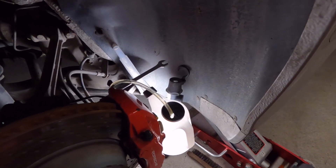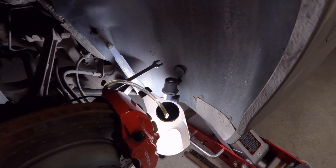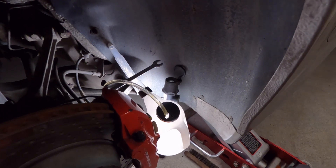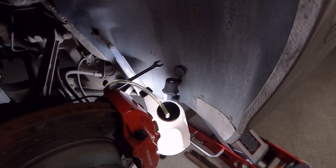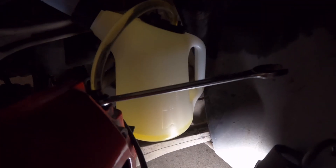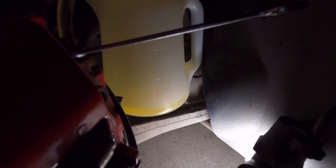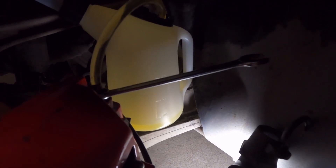Without making a mess on the brake disc, you just open it gently and let the brake fluid run in until you get the amount you want, or until you can see a difference in the color of the brake fluid. Now you can see a nice even stream coming out of the tube — just follow along and make sure it goes up to about half a liter.